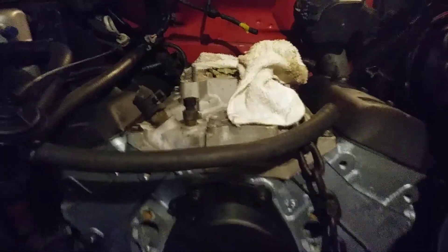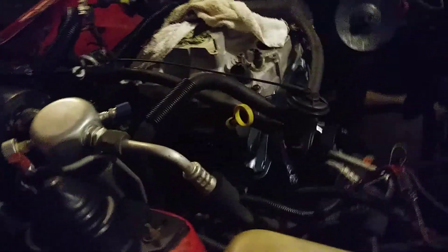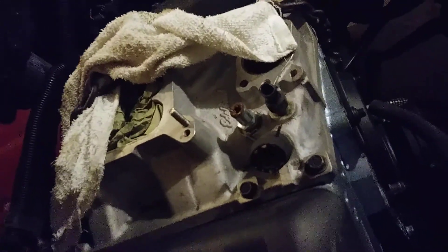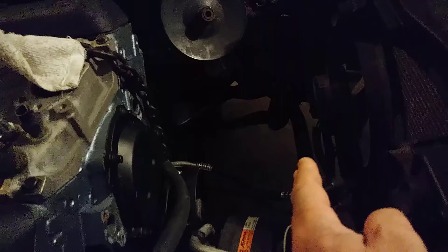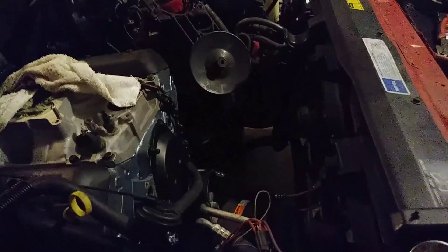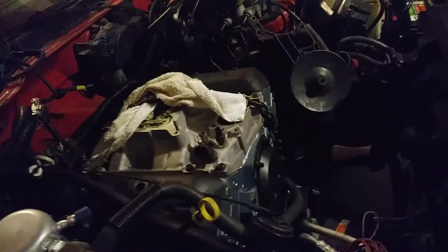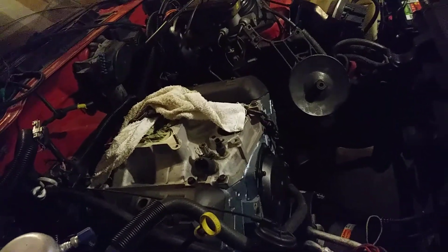Went with the old Pontiac Blue. Pontiac ain't made a motor since 1981. But it's crazy that this little engine weighs about 180 pounds less than the tune port 5.0 that was in it - came out 5 inches more. Had to pull the transmission forward 1 inch because these cars came with a 3.1, but this is a V8 car so it's got all the V8 components.